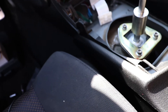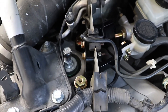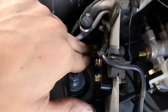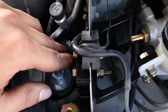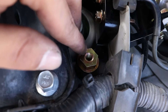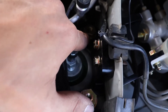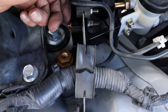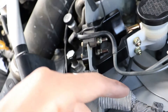Here it is installed. All in all, you need a 19-millimeter socket. This one here is a pain to take off and put on — these go on studs. This one isn't that bad, but this one here has no room with the AC line right there and your brake line. So that one's kind of a pain. You need to move things around a little bit to get it to fit, and even just getting it to sit in there was tricky. You also need a 10-millimeter here and here.